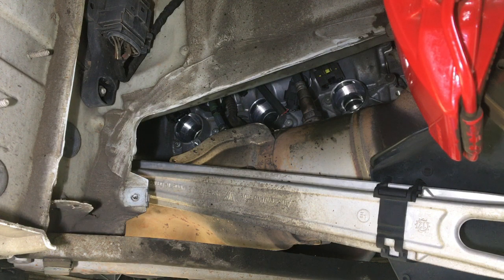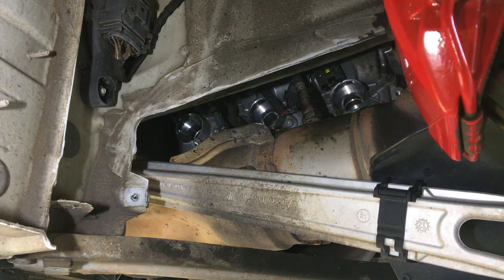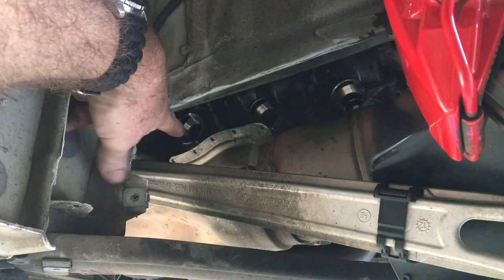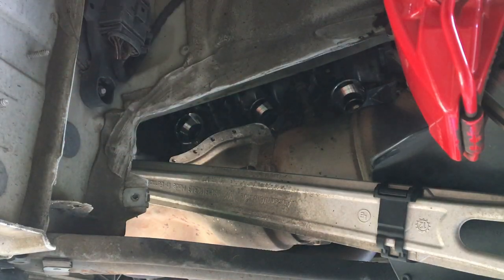This is bank two on the left-hand side. Cylinder four, which is on the far left, is a little bit difficult to get to. If you reach your hands around the front of the exhaust pipe here, that's where you're going to get most of the access, even though when you put the spanner in to remove it, you can actually bring it out this way.